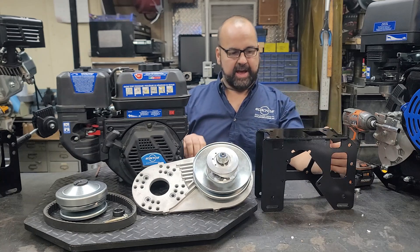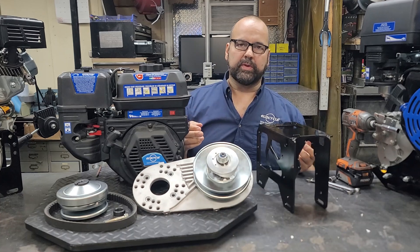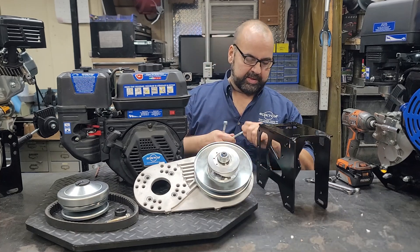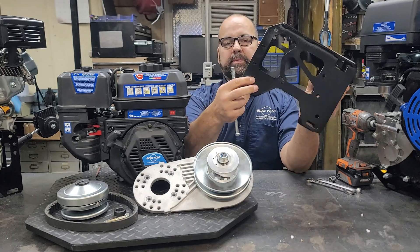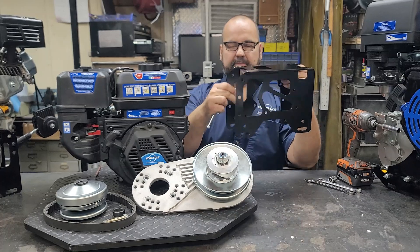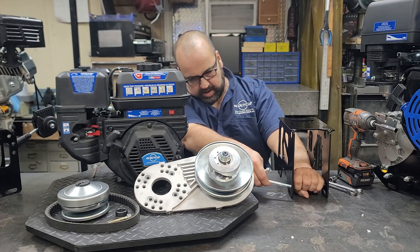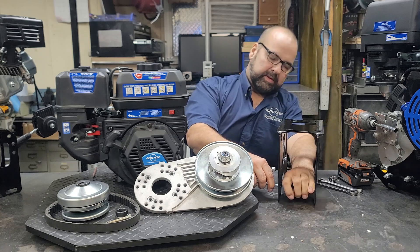This is the power pack light bracket. Generally the gearbox fits into this cavity and serves as a structural support. If you're using the CVT backing plate, you definitely need to use these spacers and three-eighths mounting bolts. You want to cross-bolt these spacers into the power pack to give the bracket some structure, since you don't have the benefit of the gearbox. These are all included with the power pack bracket kit, and you can use them at the bottom tabs or in the pre-cut holes in the bracket.